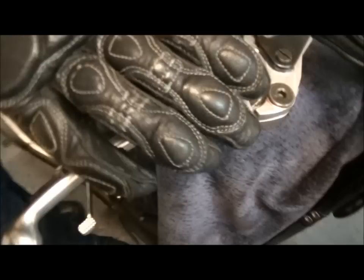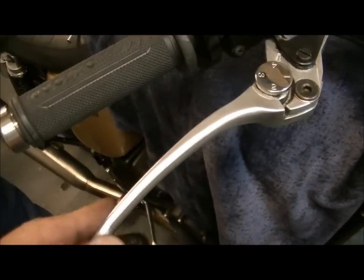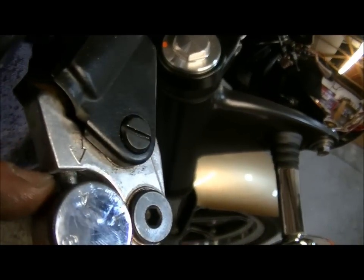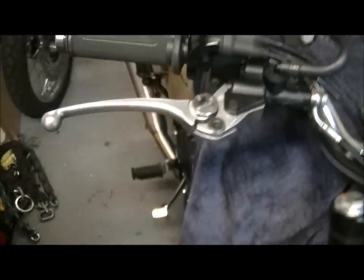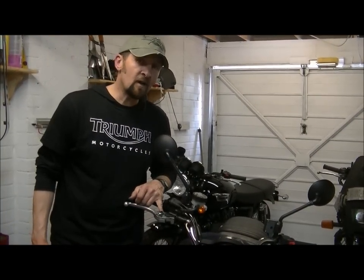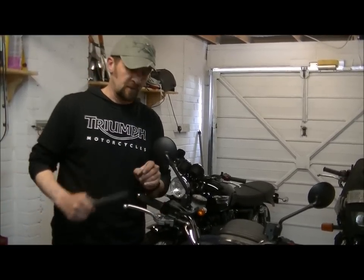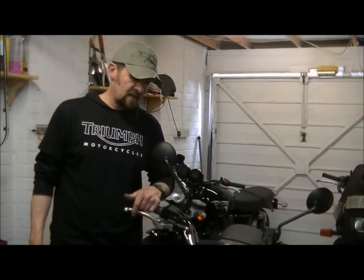So there we are, folks — a little ghetto fix for your levers. If yours aren't far enough in, don't ever try and bend this — honestly, it's just the most stupid and ridiculous thing to do. These are control levers, especially with the brakes. Just take that little pin and file it down. Don't use a grinder either because you're only taking about four mil off. If you bugger up the pin, it's not hard to fix because all you've got to do is take it out, take the end of a bolt, thread that little hole, thread a small five mil bolt in there, cut it off to the right length, round the end and use that — so they're even replaceable.